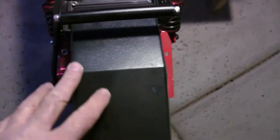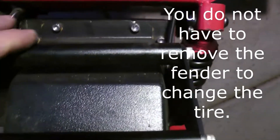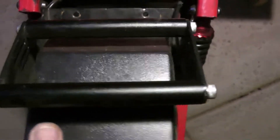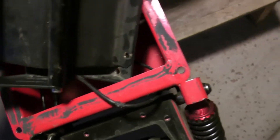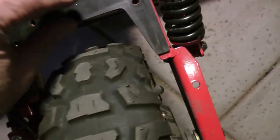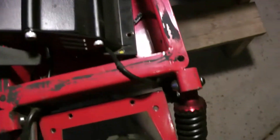Before I remove my rear wheel, I'm going to take my rear fender off first. With the deck off, there are four screws holding this whole rear fender and handle part to the swing arm. Remove those four screws and you can simply lift this entire fender-handle piece and mount off. There's still a wire coming from the brake and tail light going through a hole in the back of the chassis, so I'll just set this aside. There's also a rubber damper on the rear - I'm going to take that off too because I'm going to be painting this.